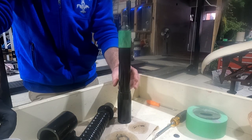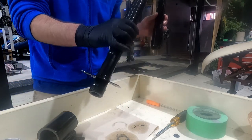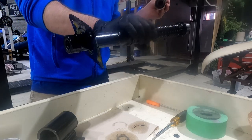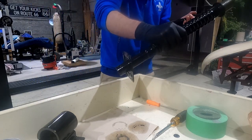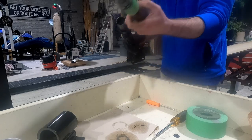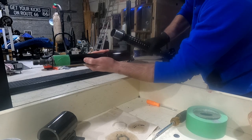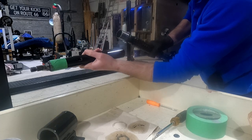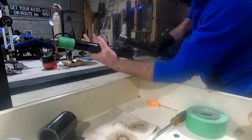We've got upper steering column, lower steering column, and you've got the orientation I told you for the bushing. So again, you want to line this up. This sits in the firewall like this, so the steering column points upwards towards you. You're going to get the upper steering column. You want the steering wheel lock on, assuming you're gonna run one. I'm sure it wouldn't matter too much if you decided to delete it, but you're going to want that facing on your right side if you're left-hand drive.